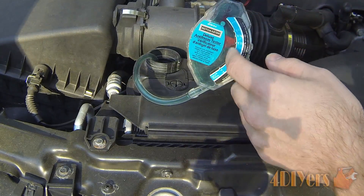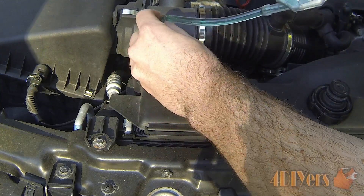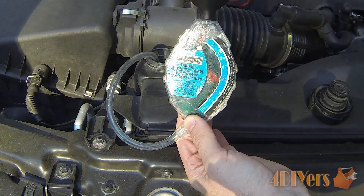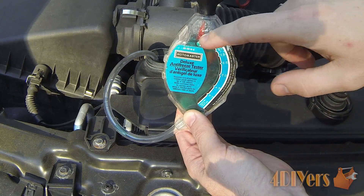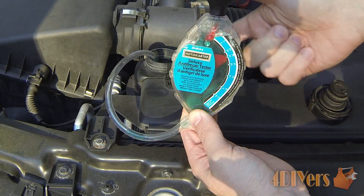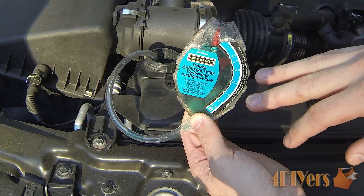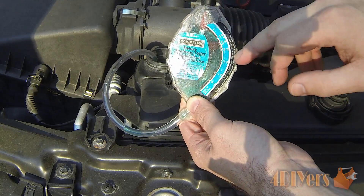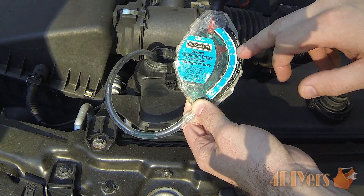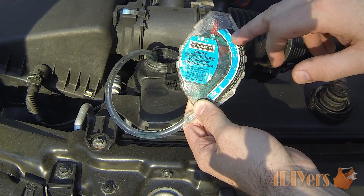We are a little overflow here so we do want an air pocket. There we go — now the reading: you want to hold it level. You can see we have a needle at the top which ensures we are holding it level. Just give it a nice tap to ensure there are no air bubbles inside, just to make sure everything is accurate. Looking at the reading here, I am good for freezing below negative 35 degrees Fahrenheit or negative 37 degrees Celsius.